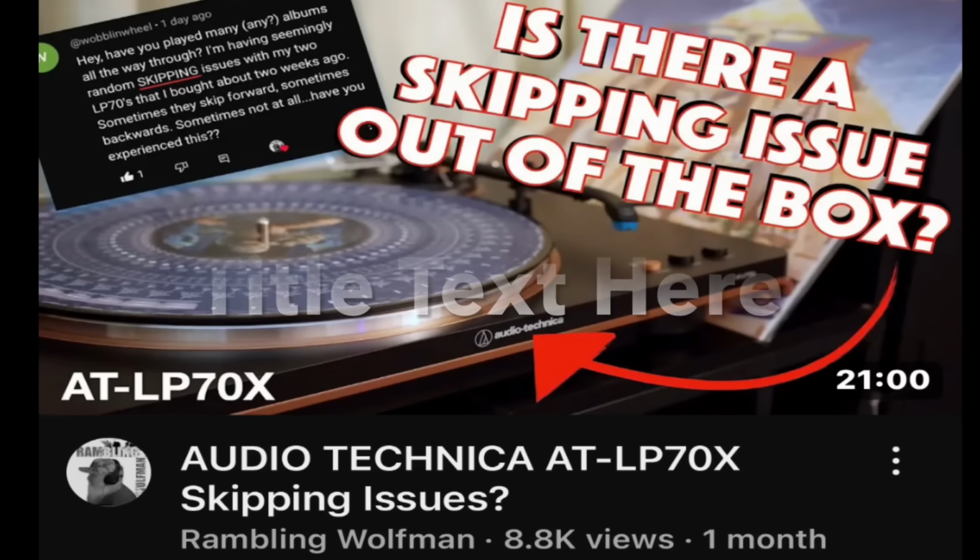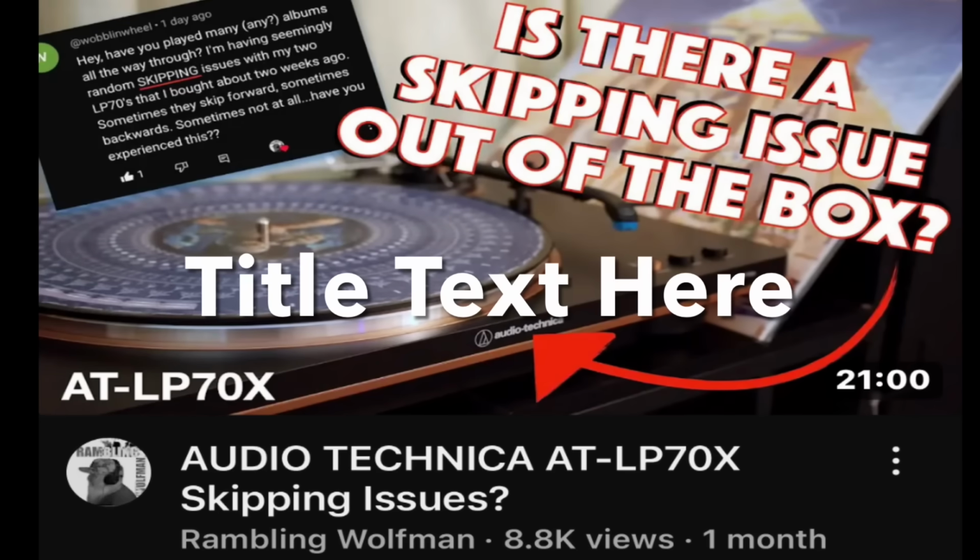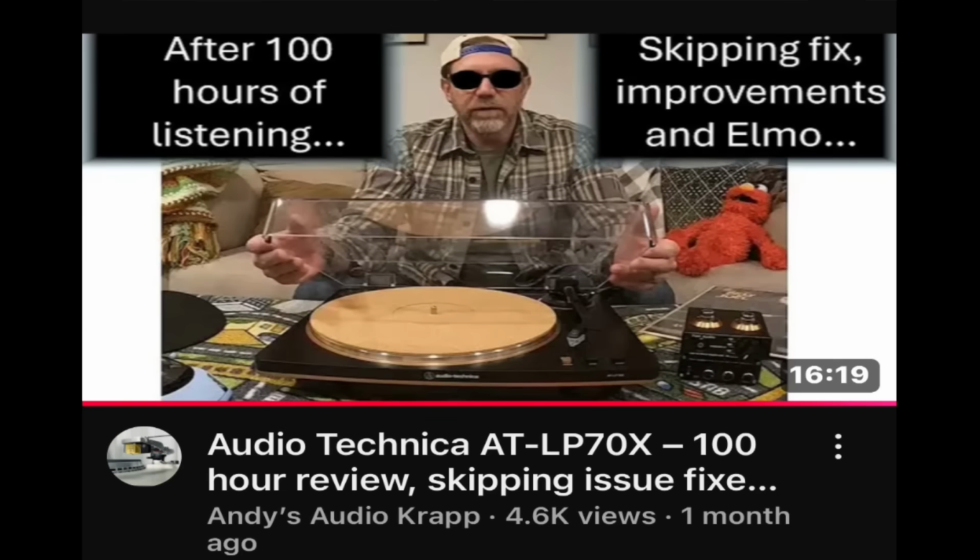So I've seen other videos out there on YouTube. People have been very creative in their attempts to fix this. The number one thing that people have talked about is adding tracking force to the tone arm. Apparently some people added putty. I would never do that. I personally wouldn't do that. This is all personal. I can't tell you what you should do or shouldn't do. But for me personally, I don't like and never do add weight arbitrarily to fix tracking issues.